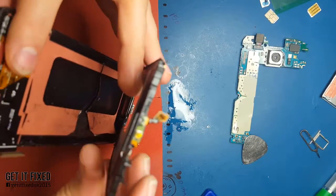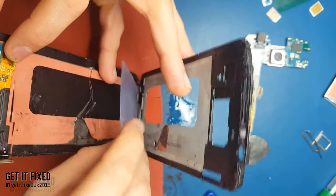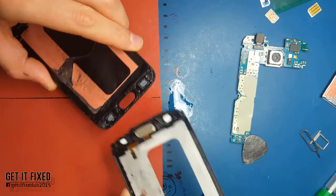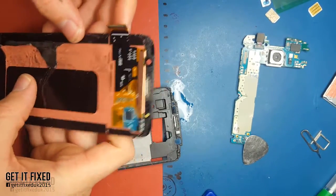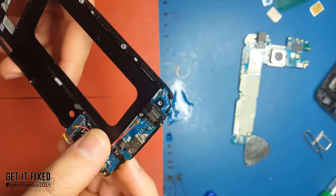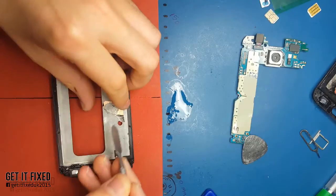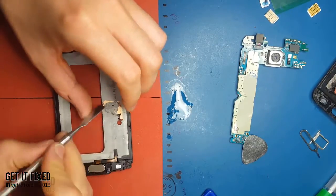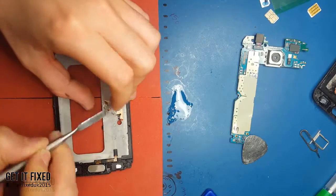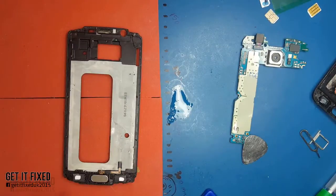While you're separating, I use a spray called Falcon 530. It's basically a contact cleaning spray which is really dry - it's not going to affect the board, it's not going to leak under the chips or onto the camera. When it first contacts air it dissolves quite fast. It's really good for removing old glue or sticky old tape - just put some spray on a cloth and you can remove it straightforward.